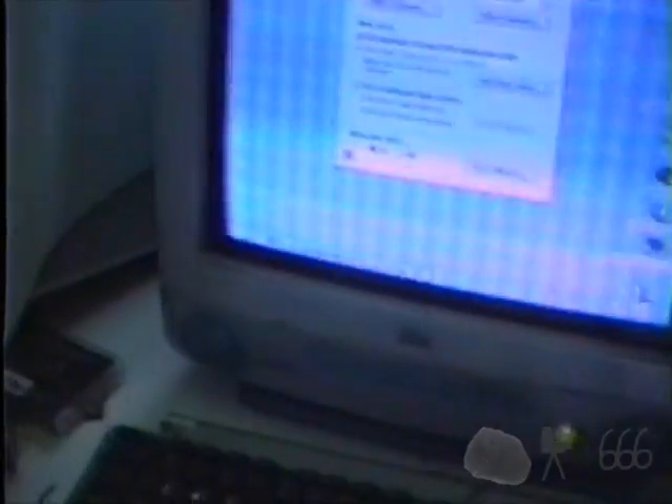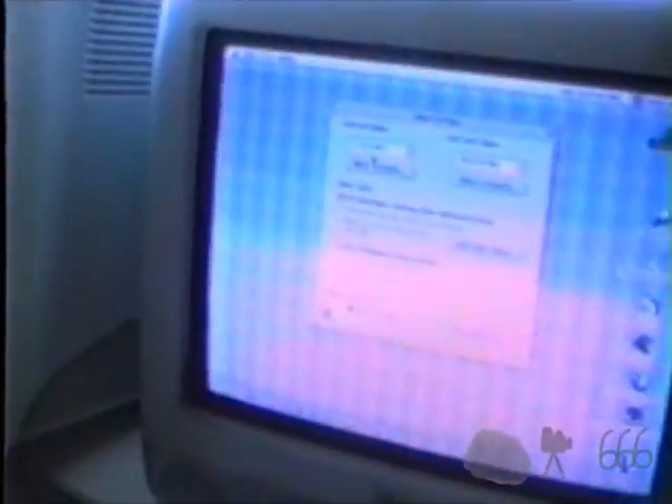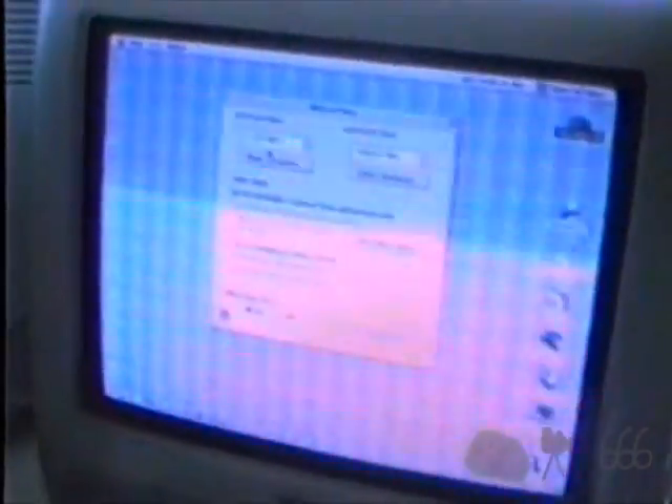And that is how you replace the CMOS battery in an iMac G3 slot-load machine. Again, tray loaders are different, at least as far as taking the machine apart is concerned. But with any system that's got those little batteries, remove them — because they are known to explode. And if they don't explode, they will still leak and they will ruin your day. So please just do that and you will save yourself a lot of headache and heartache. Thank you for watching — if you have any comments or questions, please feel free to leave them down below. This is CP666 signing off. I hope to see you next time.